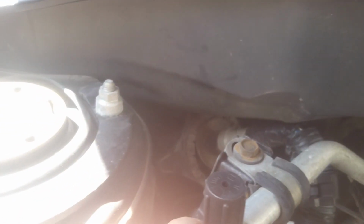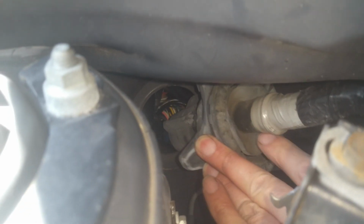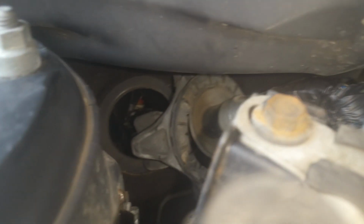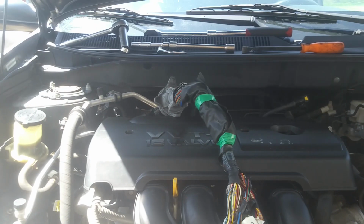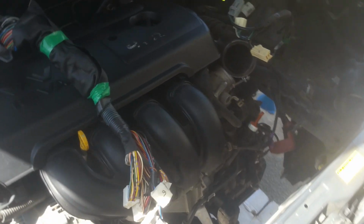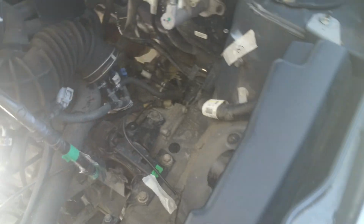Okay, so I've just come out here to the firewall and I've pulled this little weather boot through. So you can see this boot, it's a weather boot, and you just give it a pull, and we've got it loose at this point, and we can start just working this wire back through here from working inside and out, just to make sure that it's not going to hang up. Okay, so there's that pulled through there now. So we're just going to do a kind of a double check around to make sure. We should be able to go ahead and start popping the motor mounts off.